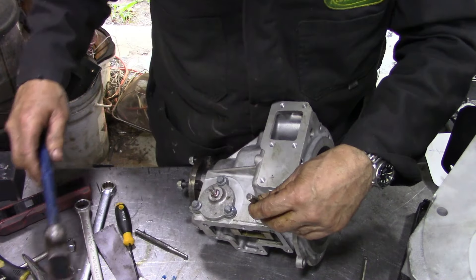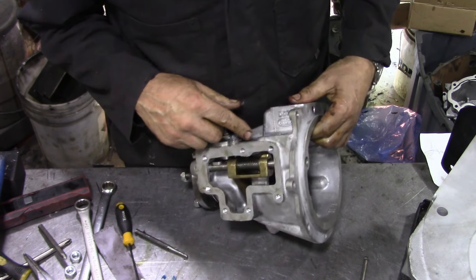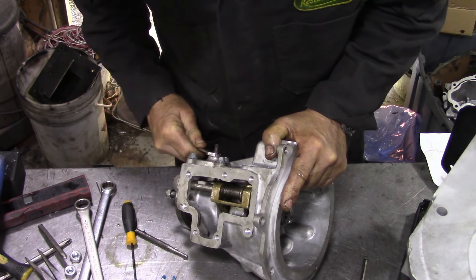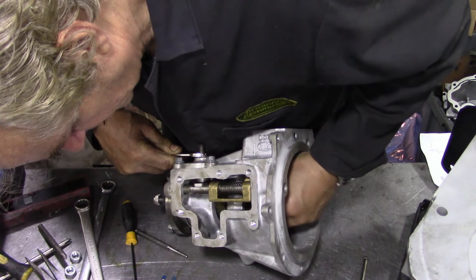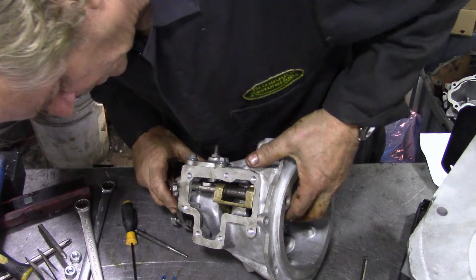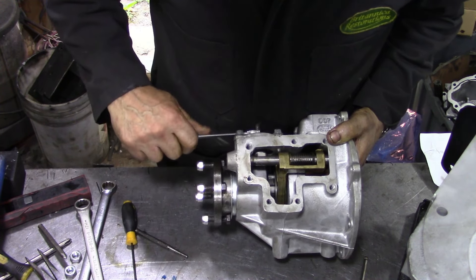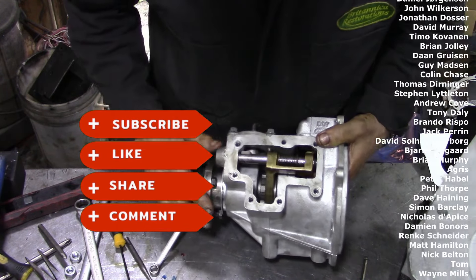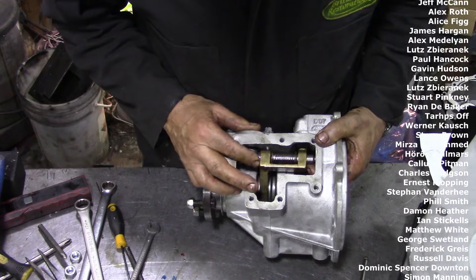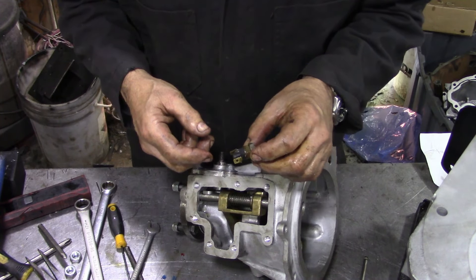We're going to get a punch and hammer and just put one punch between the aluminium and the grub screw. The other part is for your diff lock switch — we'll make sure the linkage all works. This is why it's important to get this to lock into the ring, because it drops down — you'll know if you've had a go at these. You can see the spring is under tension; I'm holding the ring — there, it dropped in, that's how it's supposed to go. That's very good. We'd better test this out before we put it back in — let's clean it up.